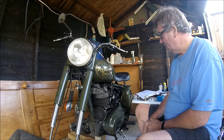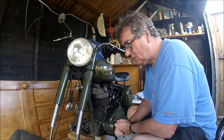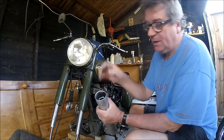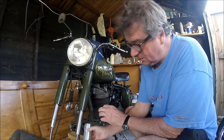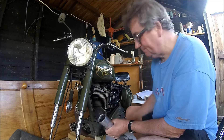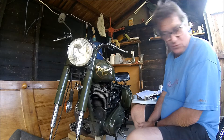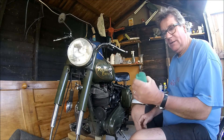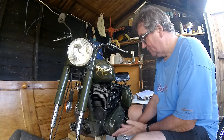The last thing we've currently been looking at is the front forks. They were leaking a lot of oil, so I've taken them back, put new seals in, and started cleaning them up. But you need a special tool for when you're putting the bottom of the forks back on — when the seals come over it, they can easily be damaged. You're meant to buy a little clamp tool to help with that. I tried manufacturing something out of bits of children's plastic cups but it didn't work, so I'm going to fork out and buy the special tool.